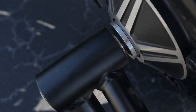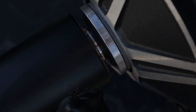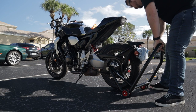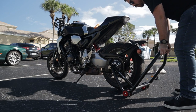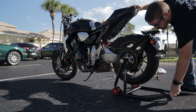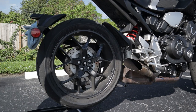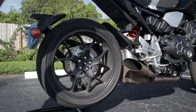There is a small flat disc that is part of the paddock stand, which is larger than the size of the opening. Start pushing down on the bar with a downward force — that's going to roll up to where the other rear wheel starts touching — and then just keep applying a little more downward force until you get it all the way in place. Now you can see we've got it in neutral and can freely spin the whole wheel. There was a question about whether you could take off the rear wheel — it seems like you probably could, though I don't know that I would necessarily recommend it.